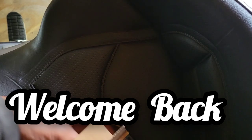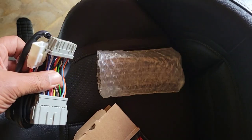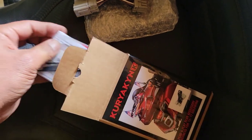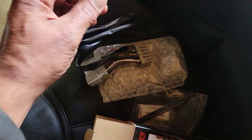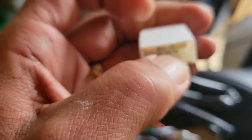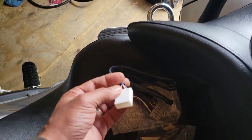Welcome back guys. If you just stumbled across this video, click that subscribe button. This plug gets installed underneath the seat, so I'm gonna have to remove the seat to do this. I got this from Wing Stuff — it comes with little zip ties, dielectric grease, and directions. You're gonna want to make this plug as waterproof as you can, because from what I've read online, a lot of people have issues with it corroding since it gets installed in a water-exposed area.